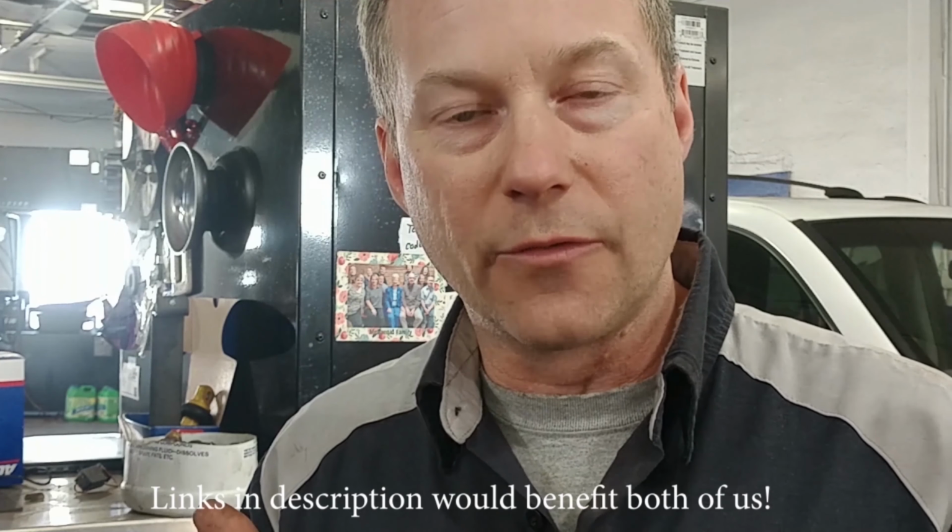Just a friction fit, slides in and out. A little bit of springing action with these little clips. Just a friction fit clip, fits in the grooves. Squealer. Looks like it's probably removable. I don't know if you can see the shine on there, but it's got a little bit of shine on it. It was hitting, so that's good. These are just friction fit. You can just pop these out, or you can leave them in and just clean them, wipe them down with some soap and water, emery cloth, something, clean them up. We have new ones, so we'll be using new ones.